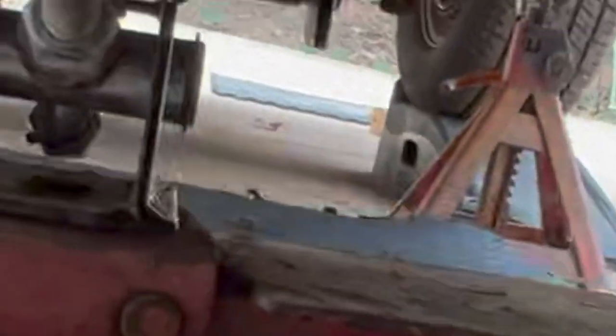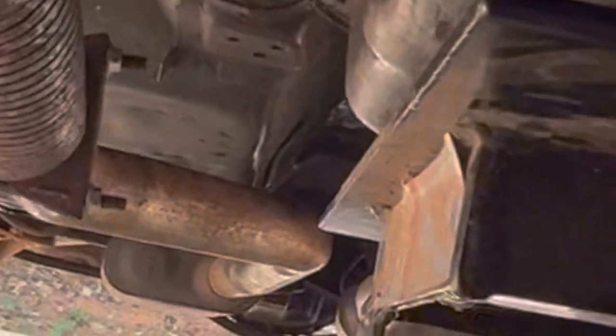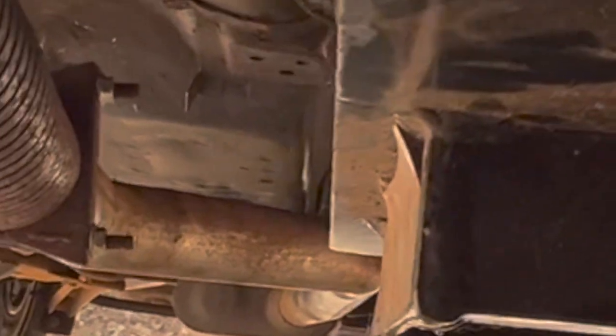What I'm going to do is get a drill bit — because you see this is flat — I'm going to stick an eighth inch drill bit in here and see how many washers it's going to take to fill that void. The idea is we want right around an eighth inch. Then we'll jack our transmission up, get it level, and that's when we'll put our cross member in and bolt it up.